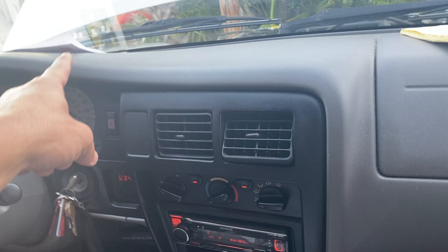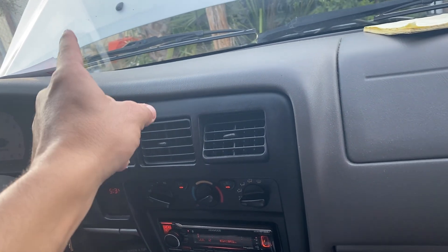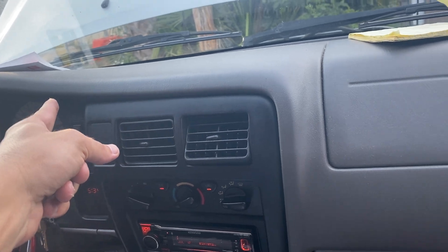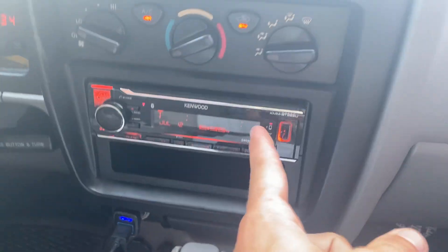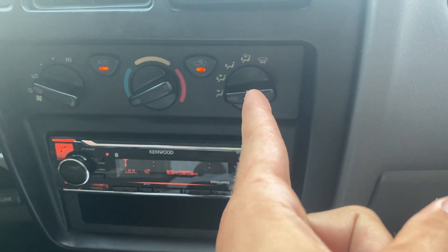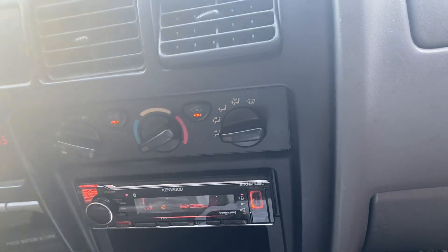When the AC switch is turned on, the AC clutch turns on. Basically what we're getting at here is you have power coming from over here at the fuse box, it runs through the heater relay and goes through the 10 amp AC fuse, and from the AC fuse it comes down into this glove box area. Just behind it there's a dual pressure switch — if the pressure is too high or too low, the switch will break continuity.